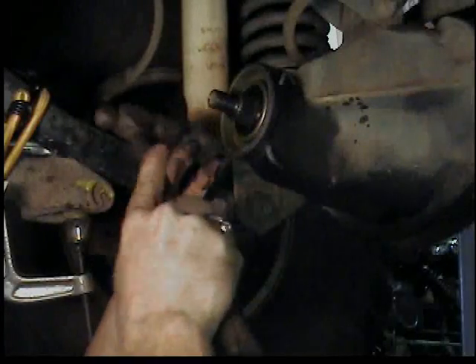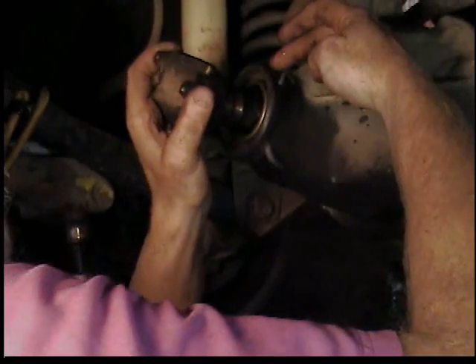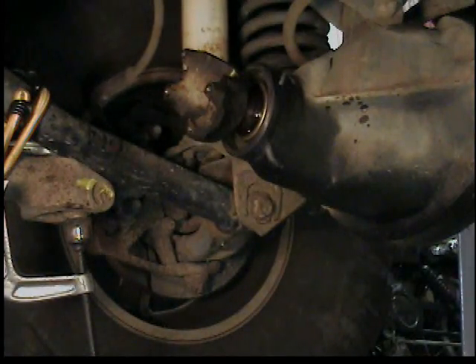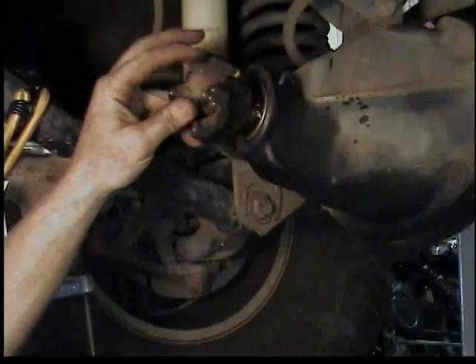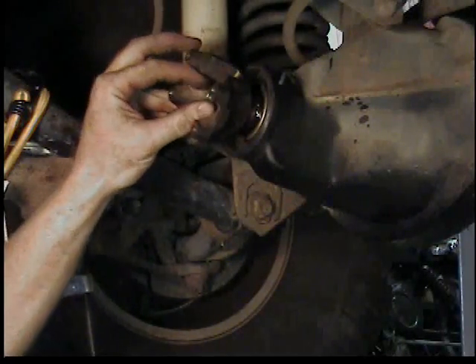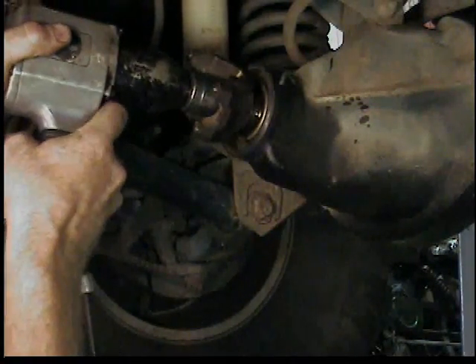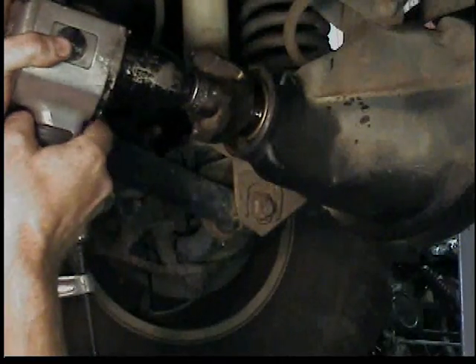Look all the way around and make sure the flange is seated against the case. Then lube up the yoke and line it up using the mark on the case so you can line it up from the other end. Put the yoke back on in the same spot, put the washer back on, then the nut. Buzz it back on with the impact, stopping a few times to check that the same amount of shaft is sticking out of the nut as before, and that all the yellow lines — the nut, the yoke, the case — are lined up. That way you know you've got the same torque on it as it had before.